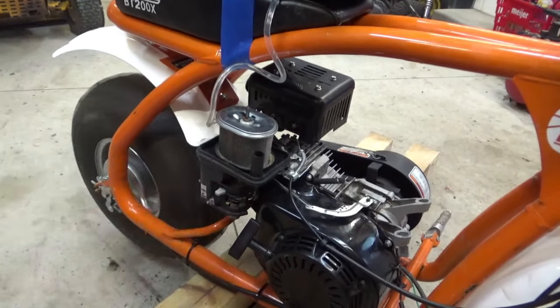Hey guys, I want to show you what we ended up with. So I used that existing bracket that used to go to the governor arm that was over here. And I put a bend in it and another bend, and I fished it to this bottom eyelet on this cover here. And I left that end the same that goes to the butterfly. And then we picked up this small spring from the hardware store. So now you can see the butterfly valve. That's idle. That's full throttle. So, it wasn't too bad to figure out. I know they sell kits online and stuff, but really, I think this was $1.65, that spring. And we reused the existing linkage there, so it should be good to go.